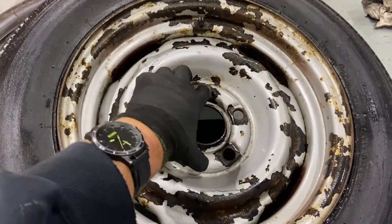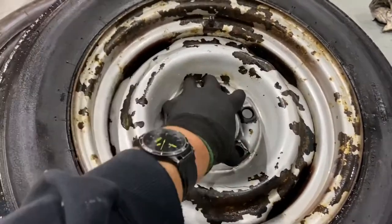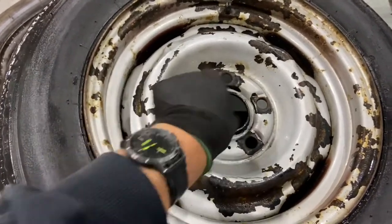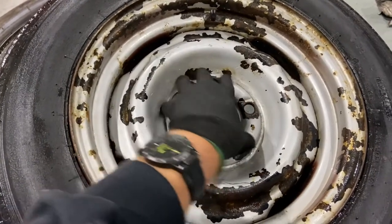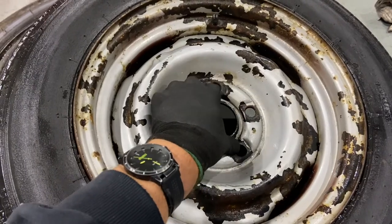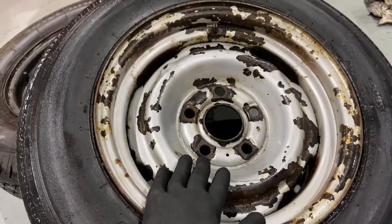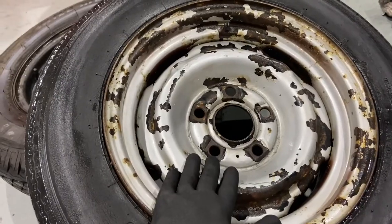And so that's bad. And what I have seen is the wheel chattering on the hub and snapping the, or because one's loose, one nut or two nuts are loose, they can come off. And chattering on the remaining studs and snapping a stud and the whole lot coming off, being quite dangerous. So my advice there is service your box trailer, caravan, whatever it is.